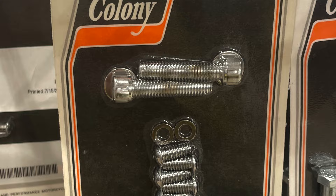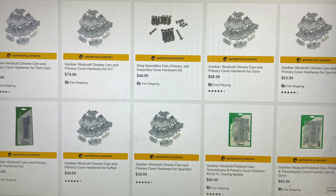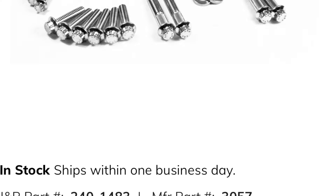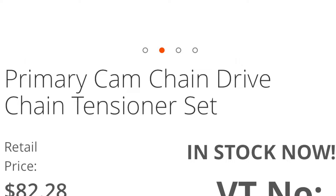Because aluminum hardware snaps so often, there's no way I would touch a customer's bike without getting them new cam or primary cover hardware. The immense vibration of Harleys and poor aluminum quality has the amazing ability to weld itself together and snap when you go to service it. Gardner Westcott kits are the cheapest insurance to keep from drilling and re-threading your bike. There's also Colony — though I don't think their chrome hardware holds torque very well. If you want top-tier, there's Fueling ARP hardware. Hydraulic tensioners are still known to fail at 40,000 miles — check them at most every 10,000 miles.